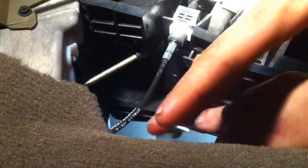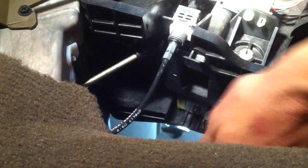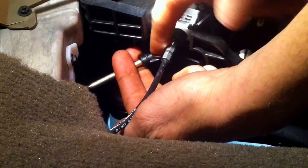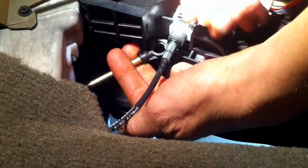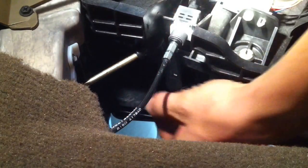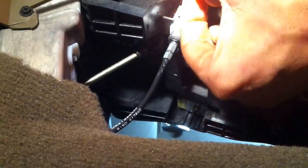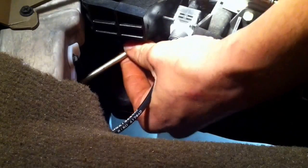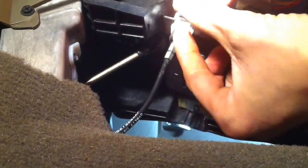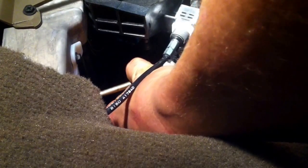Right now we're located on the driver's side floorboard, right up under the shifter assembly. If you follow up where the brass rod and cable is right here, you'll see that it's not attached to anything — that's our shifter cable. The hole here is where that bushing is supposed to sit; it's obviously gone. When we install the new one, we need to go from the back side and push it towards the driver's side. Once we've got that installed, it's just a matter of reaching up — you can feel the peg on the shifter where it snaps on. I've already put a little grease on it; I've got it seated. I'll grab some pliers and start squeezing. There we go — I actually felt it snap in.